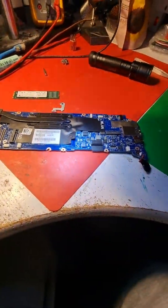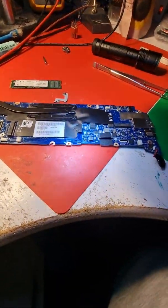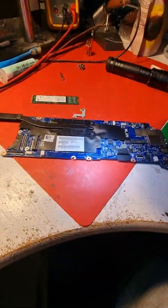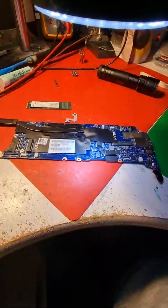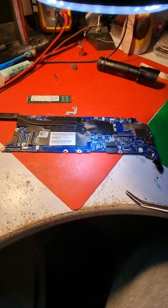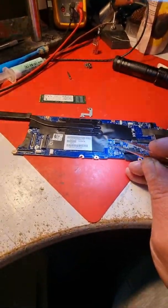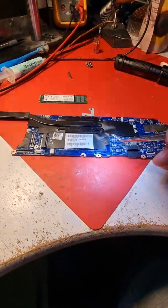So when I was typing on the keyboard on the middle part, it was freezing. I read a lot of comments and forums about this issue, and a lot of people say that if they remove the back cover the laptop works perfectly fine, but as soon as they install the back cover they have problems. I don't know about other models, but it's well worth checking if you have a similar design.